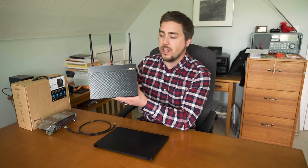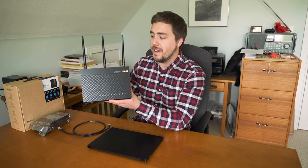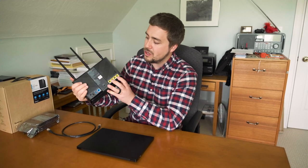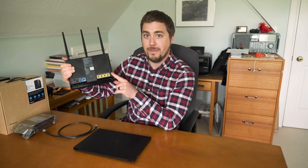Number one: this is a networked drive. What I mean by that is it actually needs to connect to your home network. So when you're planning a NAS installation, you need to find your home router. Your router is going to have antennas sticking out of it. A lot of people have a modem and a router, or an all-in-one device. Your NAS needs to directly connect to your router via one of the open ethernet ports on the back of it.